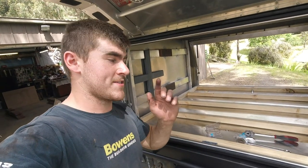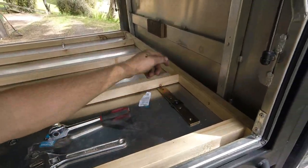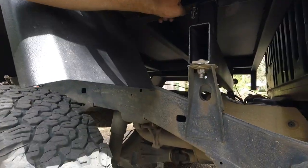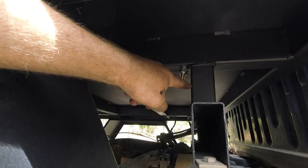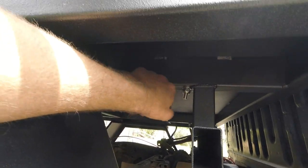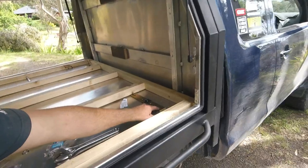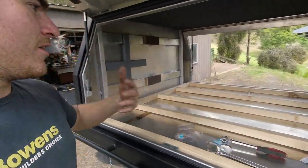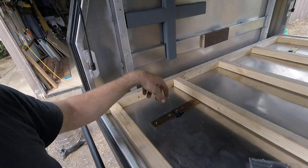A few of you are asking how I'm mounting the canopy to the tray. All I've done is drilled the holes straight through the tray and the canopy. I've purposely gone through one of the rails — it's a lot stronger than just going through a sheet. Don't do what I did and drill too close to your mount; come back a bit so your bolts are straight. Since it's sheet metal on the bottom and not braced, my washer is just a big flat bar to spread the load so you don't crack the sheet.